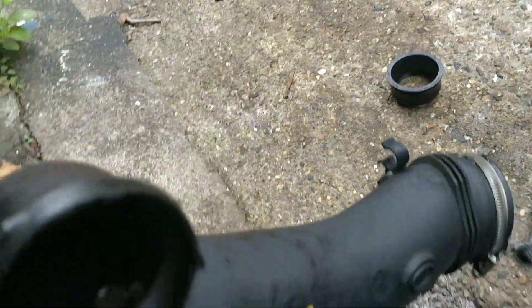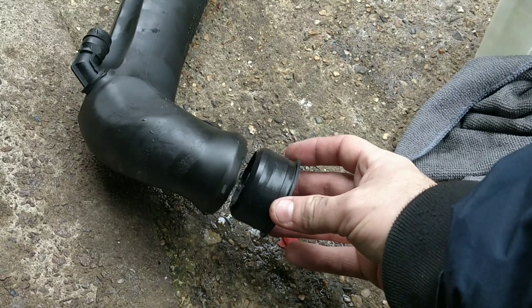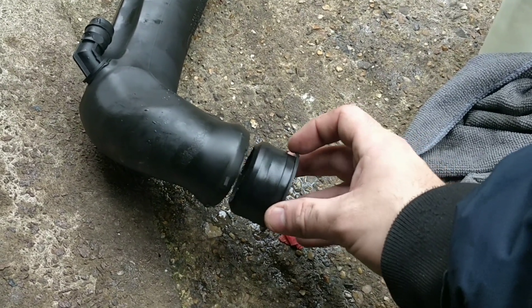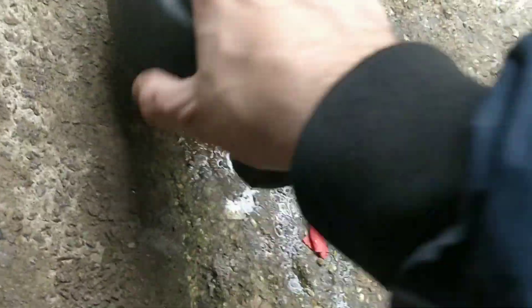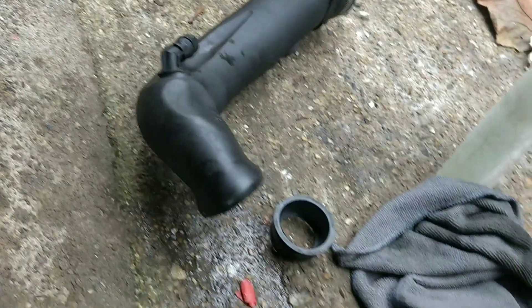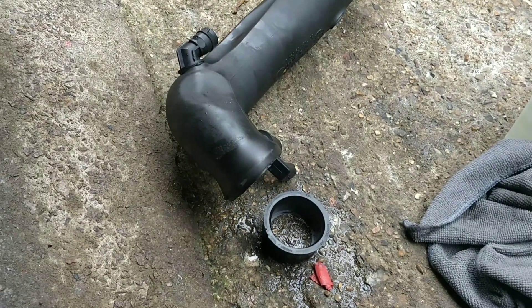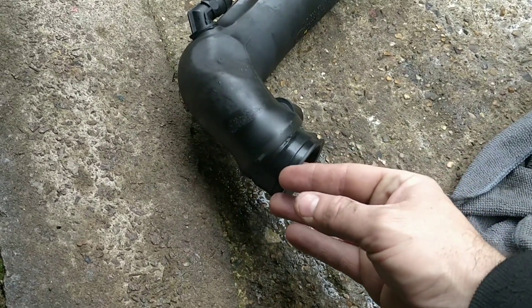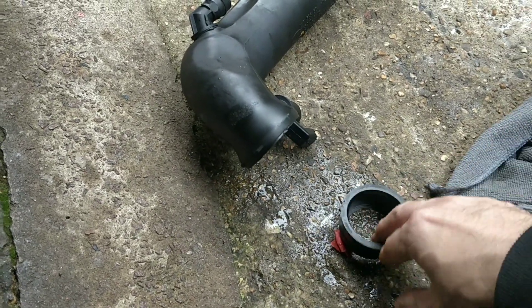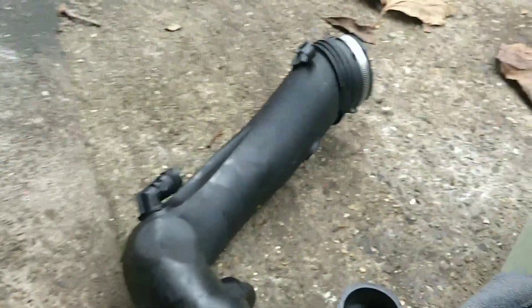After ordering a brand new one, this pipe isn't actually dead yet. What's happened is you have this in-piece that goes onto the turbo, and instead of it having snapped — which is what it looked like — it's blown itself out. The retaining clip hasn't held it in place. I'm actually going to put some glue on this and put it back in and reuse it. That'll be absolutely fine for a few days. The engine management light's been on a little while, so hard to tell — but it's been riding well and perfectly well. So for now, that goes in with some super glue just for peace of mind, and it can slide back on and be nipped back up again. I might have had a quick save here. Hopefully it really does fix the job.